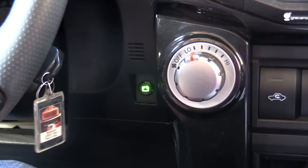The green light comes on — something's working! State of charge is at 98%. Voltage is at 13.16. The fridge just kicked on — output current is negative 3.5 amps, that's what the fridge is drawing right now. Power is at negative 51 watts. Consumed amp hours is negative 1. Time remaining says 18 hours and 11 minutes, but that's probably because we don't have enough history yet. There's also a history page that gives the deepest discharge, the average discharge, the last discharge, and the cumulative amp hours drawn.